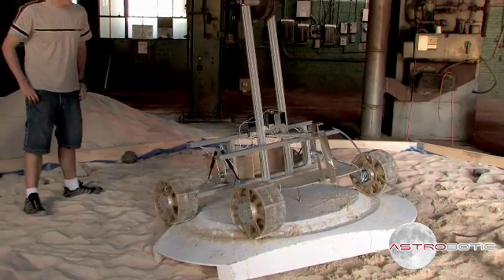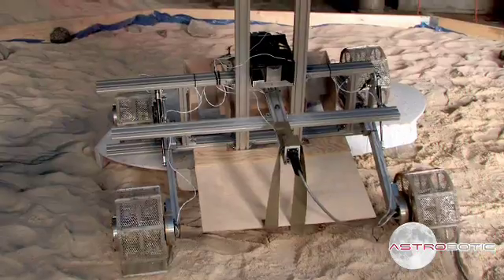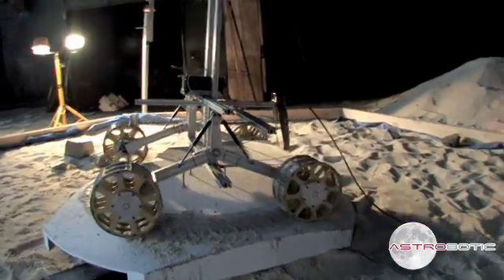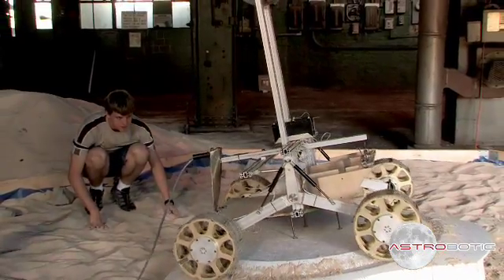If we start at a higher angle, we can skid steer down to lower ones, but we can't necessarily skid steer up to the higher ones. The scarecrow simulates our next rover design except that it is one-sixth the mass of the rover and it has the same track configuration, so we can test it in different egress positions. We also change the CG so it matches within a few centimeters.